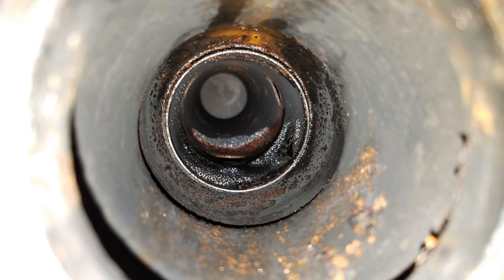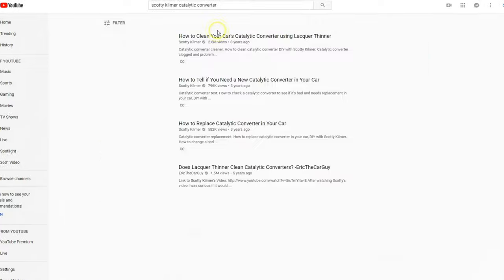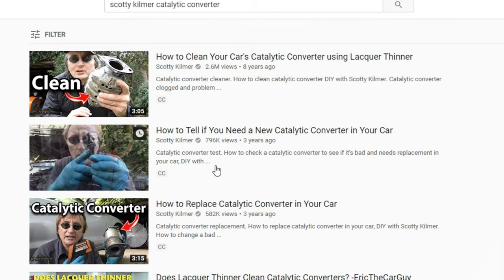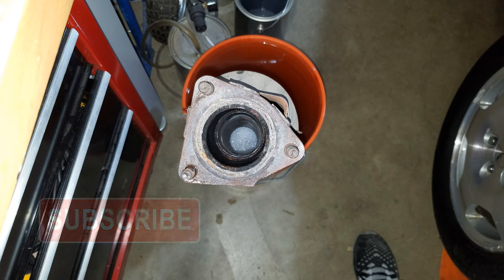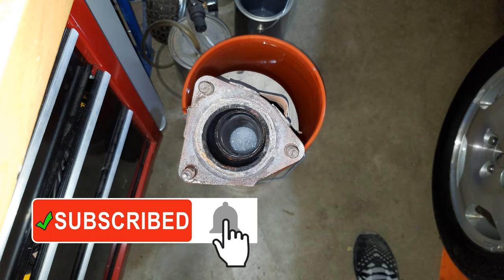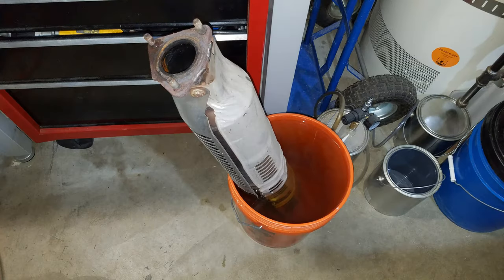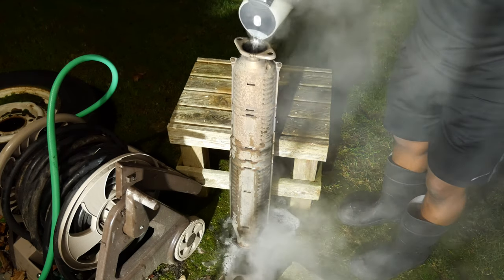Based on what I've read, unburned fuel in the cat can cause the catalyst material to heat up higher than normal and melt. I recalled a Scotty Kilmer video where he mentioned adding 1 gallon of lacquer thinner to 10 gallons of gas, then driving 150–200 miles or running the engine at 2500 RPM for a half hour to see if exhaust flow improves. I also wanted to try his other method: soaking the cat in a liquid laundry detergent solution overnight. I set the front side of the cat down in a bucket, poured some liquid laundry detergent down the cat, then poured boiling hot water down it until the bucket was full and let it sit for about 24 hours. After the 24-hour soaking period, I flushed the cat with hot water, then ran water from a garden hose through it and let it dry on its end for another 24 hours.